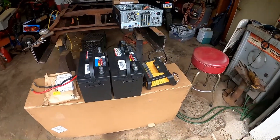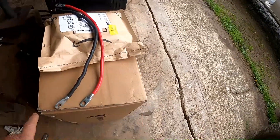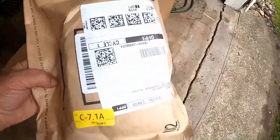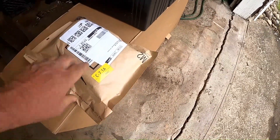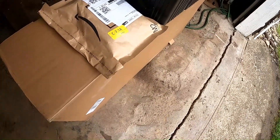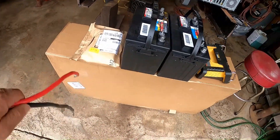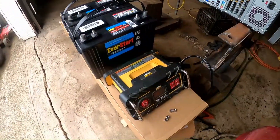We've made it back to the garage. I brought the batteries in here, and the solar system also arrived - there are four 100-watt panels in here plus the charge controller and all the cables I need to put solar on this RV. This package also has the weather head where the cables will go down through the roof, with seals and a 40-amp breaker. Since there's a 40-amp charge controller, I want a 40-amp breaker ahead of it so that if there's a lightning strike or anything beyond 40 amps headed toward the charge controller, it trips the breaker first.